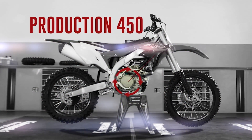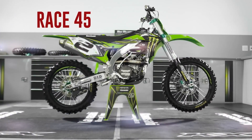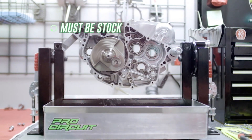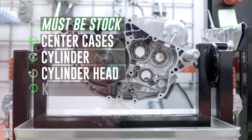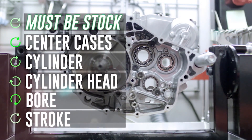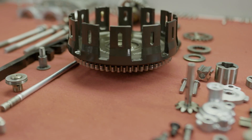Production bikes, if you averaged out the horsepower they're at and then you had a good race engine, it could be 10, 12, or possibly even 15% increase in horsepower. Internally you could do a new piston, new rings, a new rod, cam, valves, springs, buckets, gearbox, crankshaft — but you don't want to do that because it's really expensive. You just want to work on the pieces that you find you can make an advantage out of.